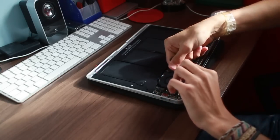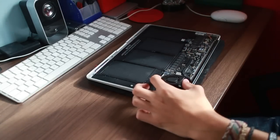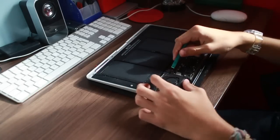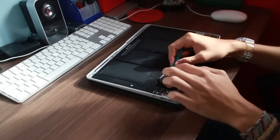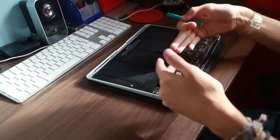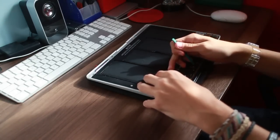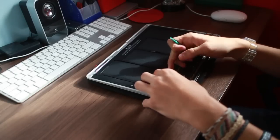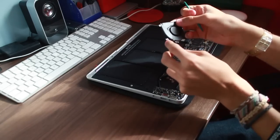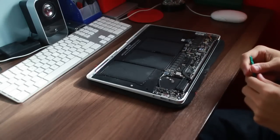This is the one fan that cools the entire system. Now there's a little connector on the board and it's absolutely tiny. A number of people have gone complaining because they've ripped the fan out without realising it's connected to anything. There's a little hinge here that you need to pop up. Obviously you can't see, so I recommend going to iFixit. I'll leave it down in the description below, but I'm just giving a visual representation over video. Lift that little hinge up and then pop it out. It is absolutely tiny, that connector, so be very, very careful. And then the fan again, put that somewhere safe.